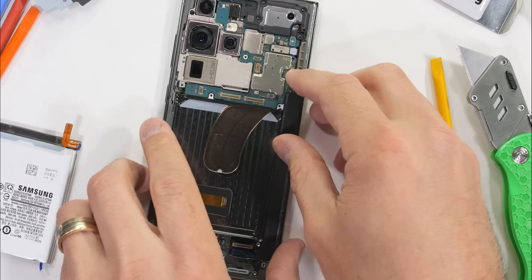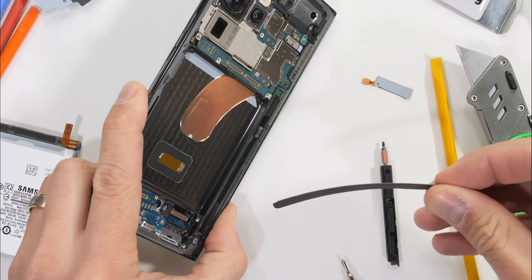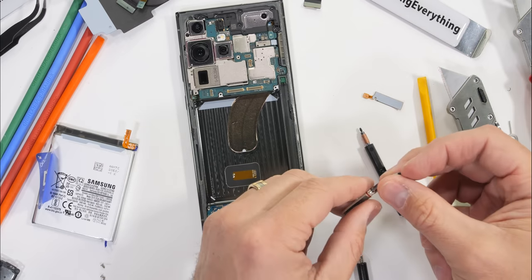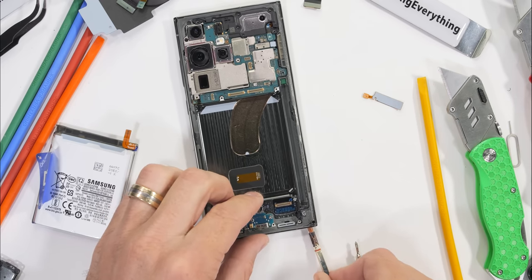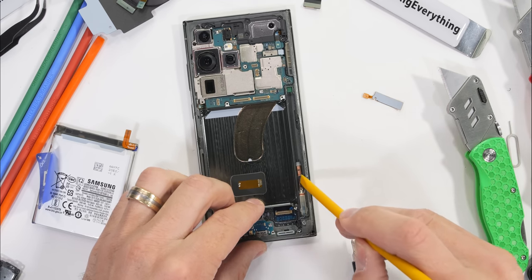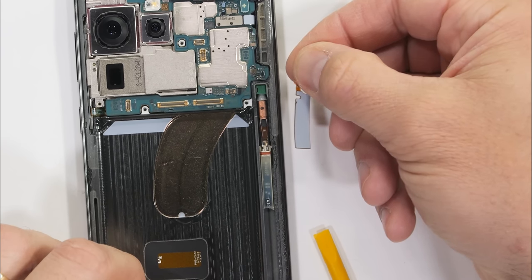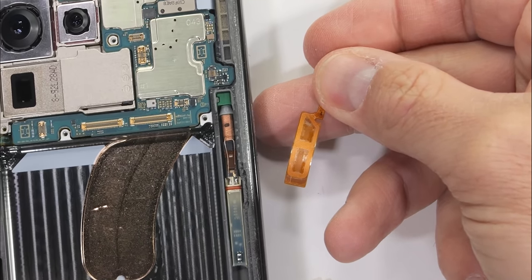It's pretty nifty technology. The lid of the S-Pen parking spot is made from plastic, since plastic and glass allow for the wireless charging coil's energy field to pass through, where a metal lid would not. And minor mistake — it looks like I was demonstrating using the stylus from the Kindle E Ink tablet instead of Samsung's S-Pen. Probably some really confused people over at Samsung for a second. But the concept is still the exact same. Thanks to our buddy Mr. Tesla — the inventor one and not the Twitter one — the S23 Ultra can charge itself and its stylus without any cables.